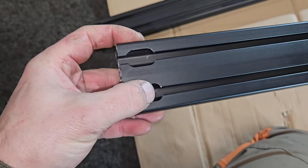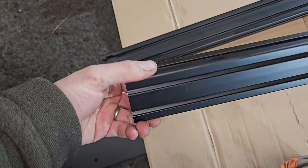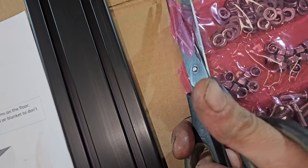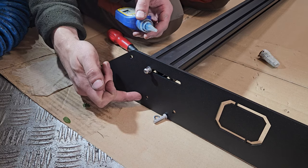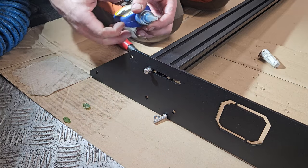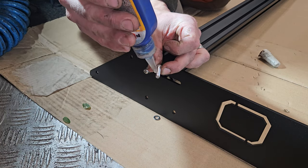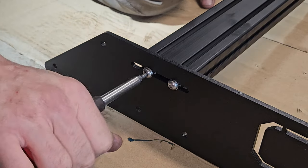The cross members have a cut-out, and that's for slotting — you can put M8 in there and bolt stuff down like boxes and other things, so you want that on top. Just some things to bear in mind before you assemble. Also, those two holes there are actually for the gutter rails — so it's this slotting here. I'm going to use a bit of Loctite because it's going to be on the roof and on dirt roads. Not going to go too crazy tight just yet.